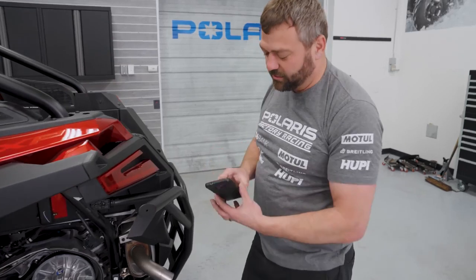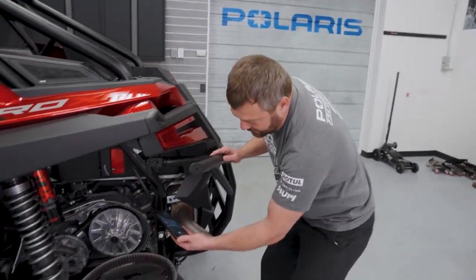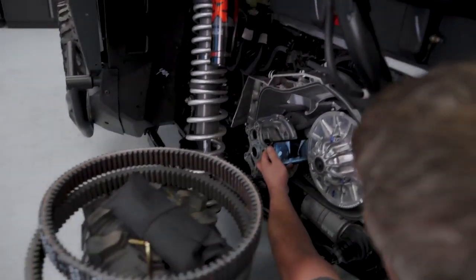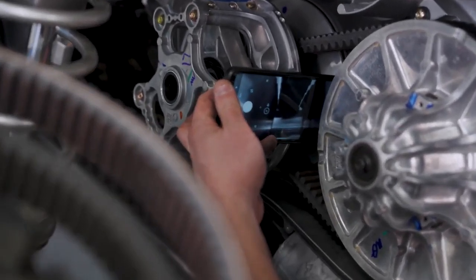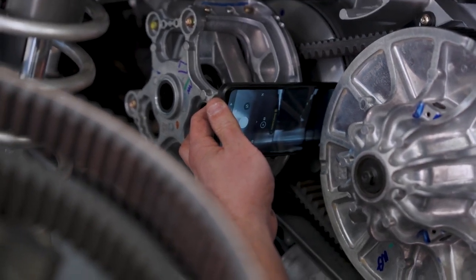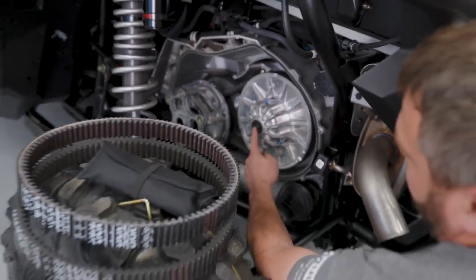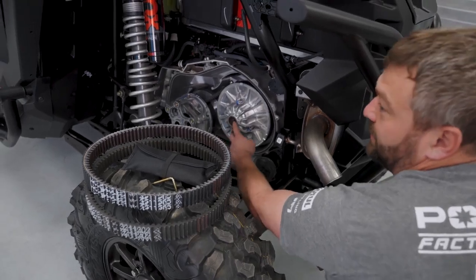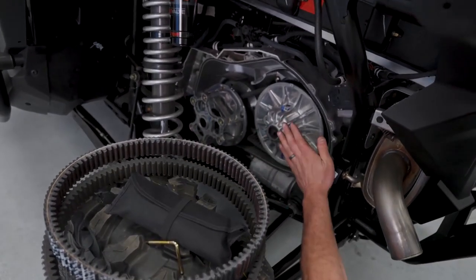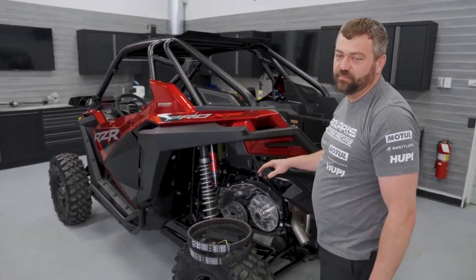Pro tip: if your machine is getting really hard to shift when the engine's running but pretty easy when the engine's off, grab your smartphone and put it in camera mode for a live view. Slide it between the clutches with the engine off so you can see where the belt is riding between the two sheaves. If you can see daylight on both sides of the belt, you've got a properly aligned belt. If it's biased toward either side, pull the bolt off the secondary - there are shims below - and add or remove the shim to offset the driven and line that belt back up perfectly.